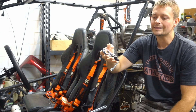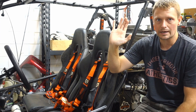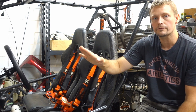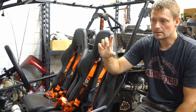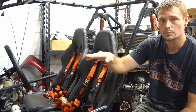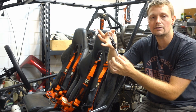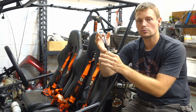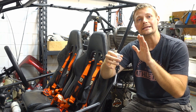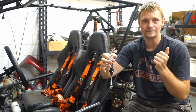So what that means, and why this adds such a tremendous amount of performance to your turbo vehicle, is rather than coming off of the throttle and closing the throttle plate and losing all of your boost, you literally will leave your foot fully depressed on the throttle. The throttle body remains 100% open, which means you're still getting 100% of that boost pressure. Then when you're going to shift, it adds a secondary rev limiter. And then when I release the clutch, it will release the switch, which then the engine will start to rev again. So that way we can leave that throttle fully wide open, gaining our boost pressures immediately when we shift gears.